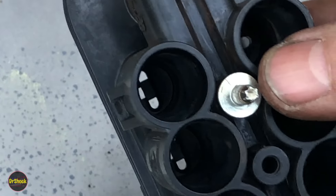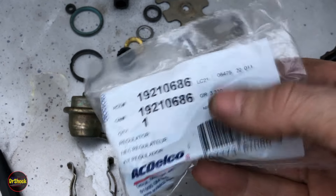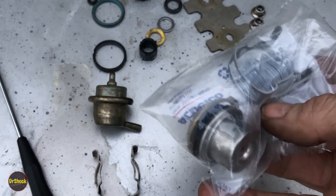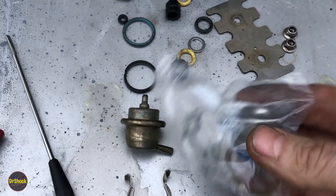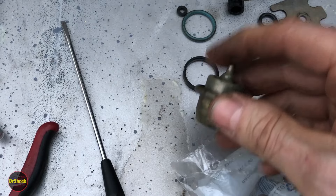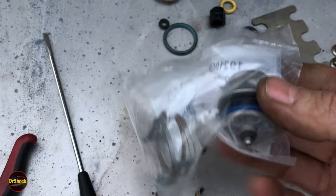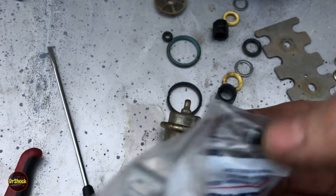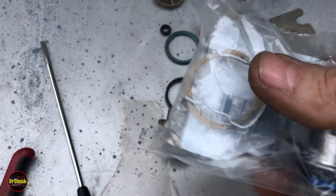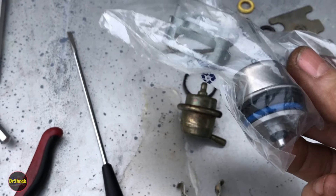For reassembly, one of the first parts we're going to use is part number 19210-something — a new fuel regulator assembly. We've got a new retaining bracket and a new regulator. The design of the new regulator is a little different from the old one: it doesn't have the little relief piece at the end. We've got our black ring, our blue O-ring, the O-ring on the very end, and a filter. Inside the kit there's also a snap ring, but this particular design doesn't use the snap ring — we're just going to use the clamp ring.